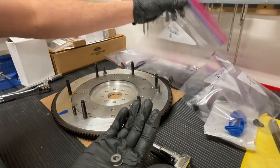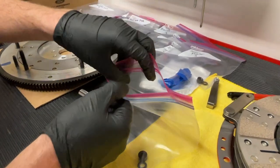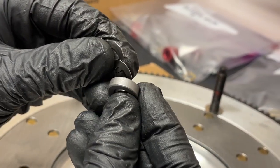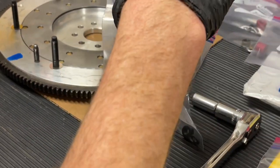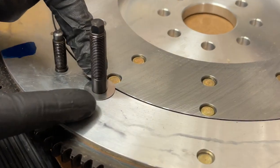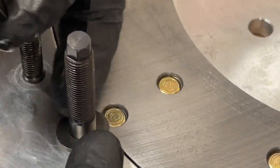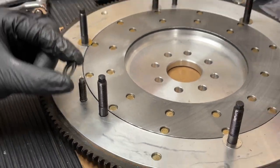Floater number one is clocked and bagged. Floater number two has the same setup — a spacer with two shims on top. I've seen other people who received extra shims with theirs; I didn't see any extra shims with mine. You'll also notice that under the pressure plate studs there are also tiny shims on the bottom — two of them. You've got to really watch out for this hardware and make sure it does not fall off during disassembly or reassembly.